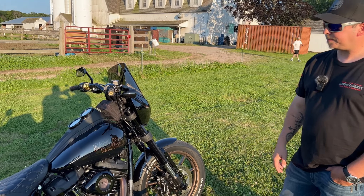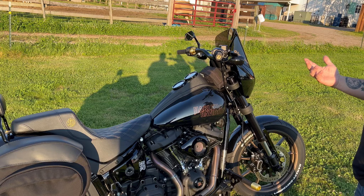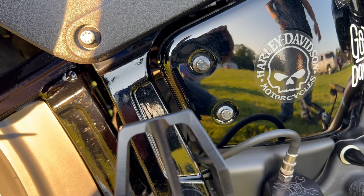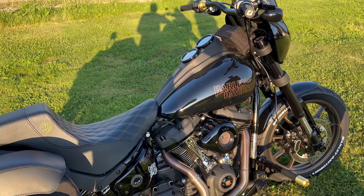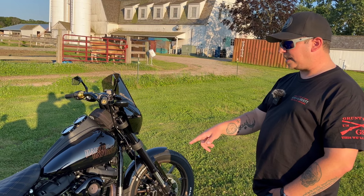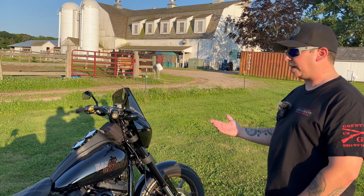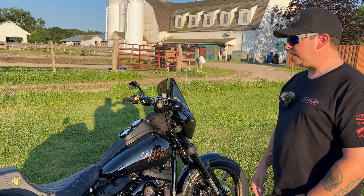A small part I did that I really didn't expect any change from but was surprised by was the Fueling vented oil dipstick. A lot of people talk about having some sort of crankcase vent on these M8 engines being beneficial. What I noticed — and was really surprised by — is that these bikes have what everybody calls rev hang: you're sitting still, give it a quick rev, and the RPMs hang before coming back down. When I did the vented oil dipstick, it got rid of that completely. Throttle response is a lot snappier, no more rev hang. Not a performance gain, but it made the bike feel like it rode differently and was more fun to ride.